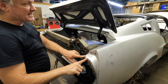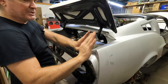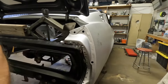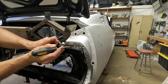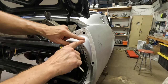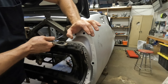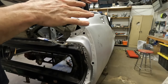One thing that started to happen on this side — because I was working hard to get this gap to where I needed it — it started to push the quarter panel up. You've also got to keep an eye on the distance between this piece here and the little fold on the rear valance panel. What was happening, I was wanting to push this up, so when I got it to where I wanted and had it marked with tape, I had to push it back down and crimp it with a pair of vice grips, then put my screws in to make it fit.